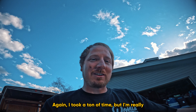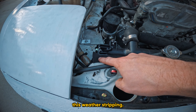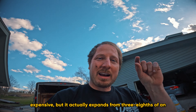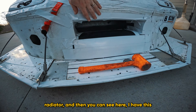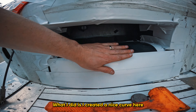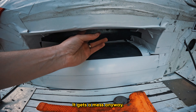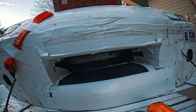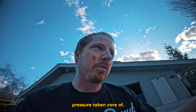Now let's talk about the splitter and radiator ducting. I took a ton of time but I'm really happy with how it turned out. I have the radiator ducting all sealed — I went through three different attempts with different weather stripping to find material that expands from three-eighths of an inch up to an inch and a half, forming a really nice seal all the way around the radiator. I created a nice curved duct so the air stays attached as it goes to the bottom of the radiator for really nice efficiency. The hood doesn't have venting yet due to time constraints.